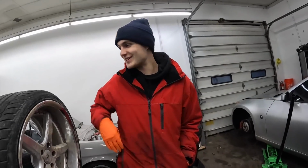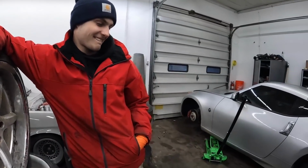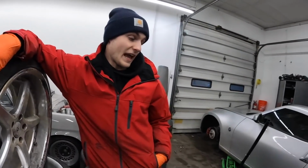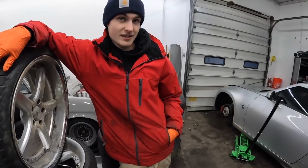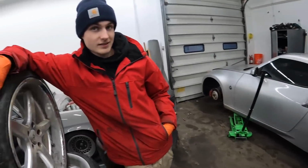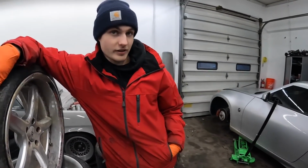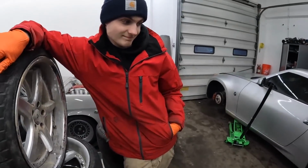Something about them is a little weird. The good thing about 350Zs is I think they're a lot less wide. So an 18 looks good. Like Adam has a 350. Dude, Grant's running an 18.9, zero offset. This is an 18.9 and a half, given the offset's a 22. But his fit perfect, flush. These were like 2 inches sunk, which is wild.